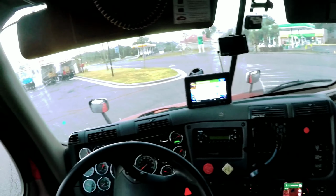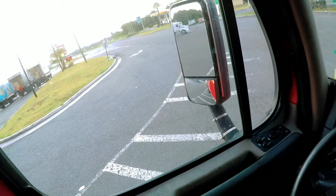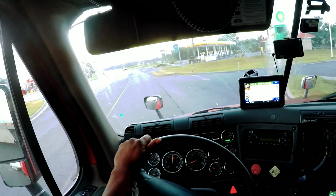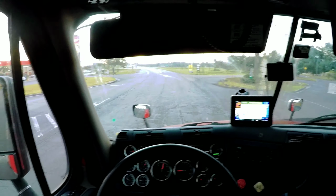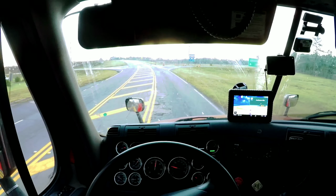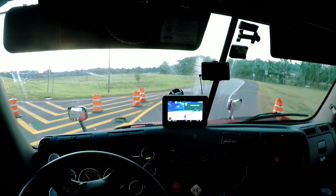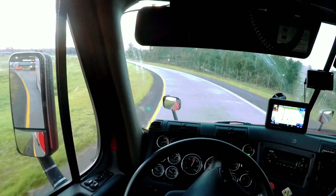For Florida, but the only thing is the truck not going to ride as comfortable like it did before, because when I was in number 13 the weight was more balanced, it was just about even. Turn left onto Scrubby Bluff Road. In 600 feet turn right onto the ramp to I-95 south. No, I'm in hole number 5. The weight not even. I have more weight on the trailer than I have on the tractor. Turn right onto the ramp to I-95 south. When you ride a lot like that, you wear down your trailer tires fast, because it's a lot of weight on the trailer. In a quarter mile, merge onto I-95 south. And you also feel like you're pulling the load instead of carrying the load.